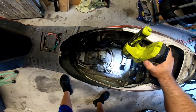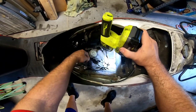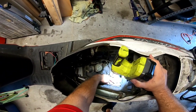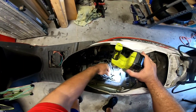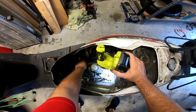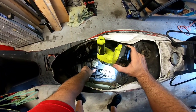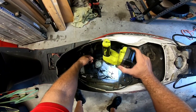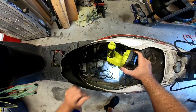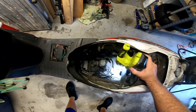So all I have done right now: this would be plugged into the bottom of the carb, and then this gets plugged into that petcock fuel system. You would just be unplugging it right here, disconnecting both vacuum lines, plugging these two, and then directly running the main fuel line that goes on the bottom of the carb - drill a little hole in the side of the carburetor adjustment, run it out of that, and plug it right into the gas tank. You can add a fuel shut-off switch if you want.